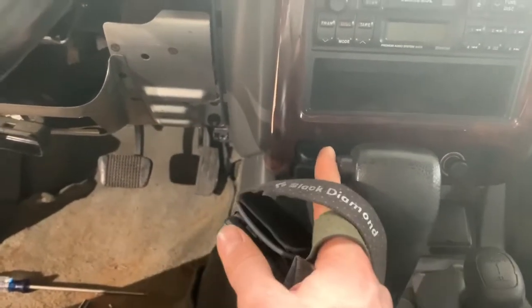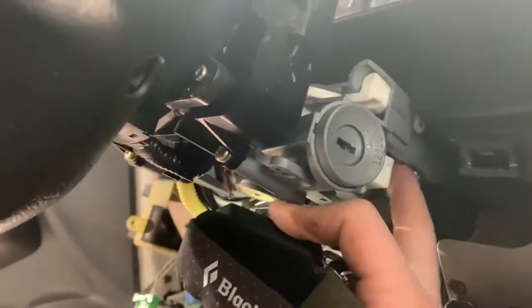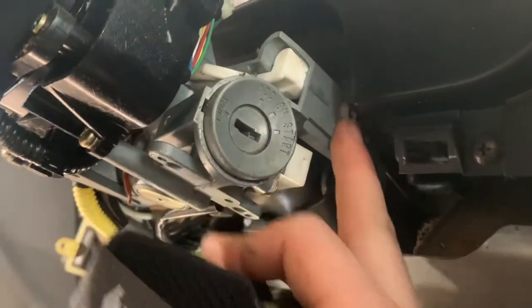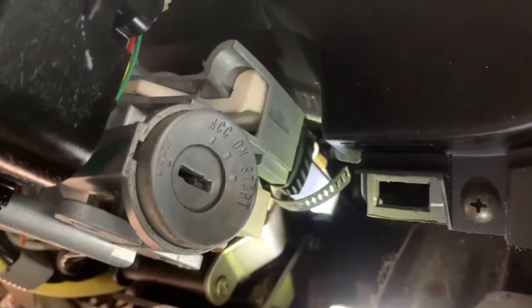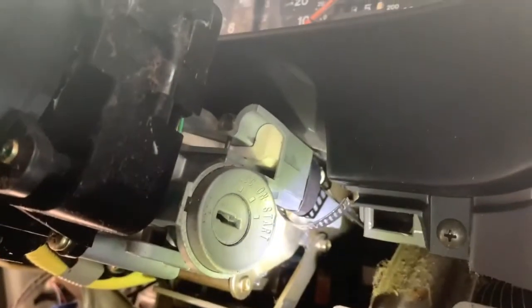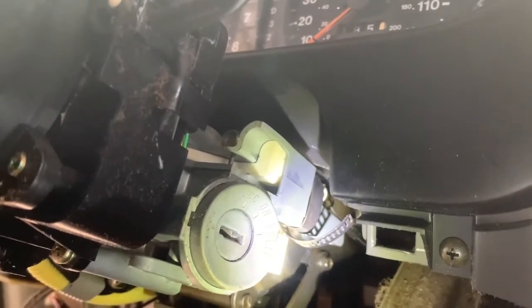The gear shift would pull the cable and release — pull, release. So what I did was I just cut the cable off, and I'm going to put a hose clamp to keep this thing in the rearward position, right here. I got the hose clamp on — you can see it right here — and that's essentially locking that plastic piece so you can take the key out.